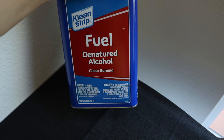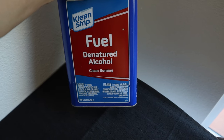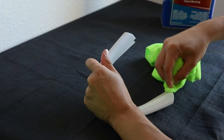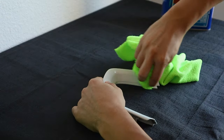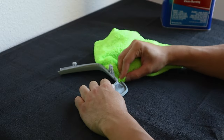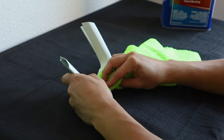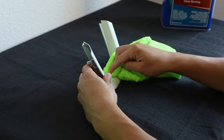This is specifically what Leo uses, and you can load it into a spray bottle for an easy way to clean larger pieces. When cleaning these pieces, be as thorough as possible. Clean the surface you're wrapping but also the backside, because the beauty of removing the pieces is you can fold the ends over to the back for a clean look with no visible edges. Make sure the back is clean so the vinyl can stick just as easily. General rule of thumb: clean it as best as you can, then go again.